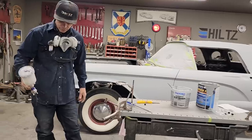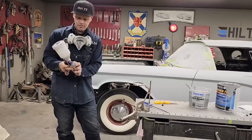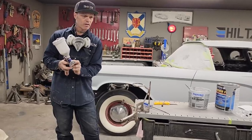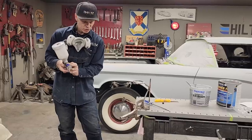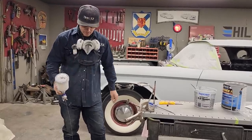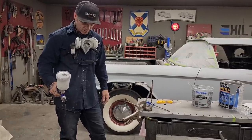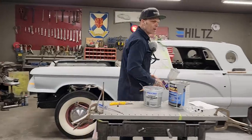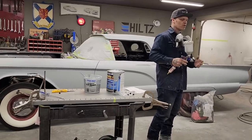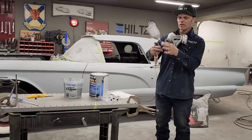Aiden did a little spraying with the gun yesterday, and he did the trailer. He painted it black with direct metal black paint, and he did an excellent job. I know that because of the time he took, he went over every little piece. But when he was spraying it, I noticed when I went out that it wasn't shooting much paint out for him. And the two places that I go to first, if the paint is not coming out of the gun, is the nozzle comes off.